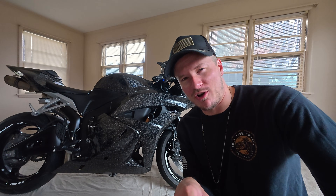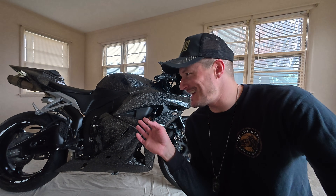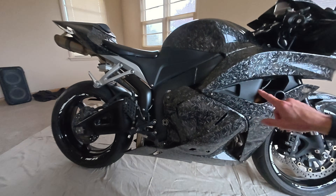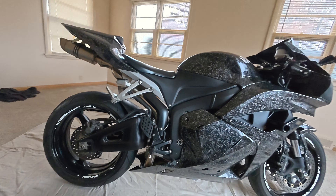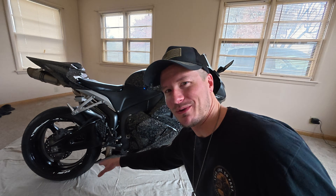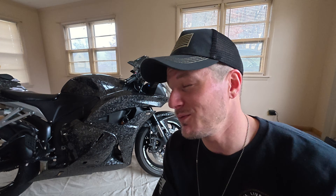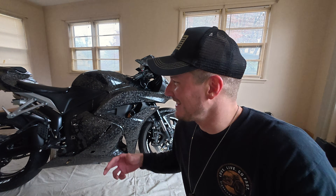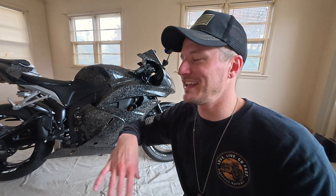Our bike never lost any power. Our bike never ran too lean with the system that I did. I think that's just the layout of these Honda CBRs — the exhaust system is so long there. If we had like an R6 or a ZX6R where it jetted out right here, sure, if we did a full exhaust and didn't get a flash, we'd probably be running a little bit lean and would have lost our low-end torque. We didn't lose anything on our CBR, but we certainly didn't gain anything, not even an ounce. So with an ECU flash, we can reap all the gains from our full exhaust job.